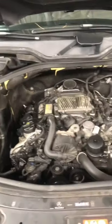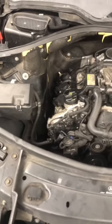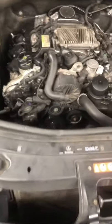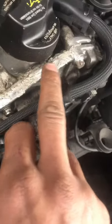The smoke is coming right out of here. Usually with a problem like this in an engine, I wash it down, put dye in the system, let the car run up on the lift and see what the dye comes out of. But this was so obvious — somebody already tried to repair it.